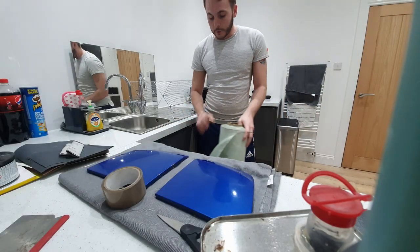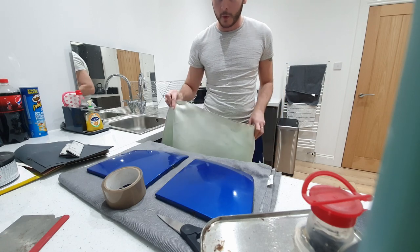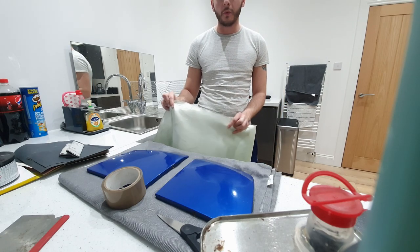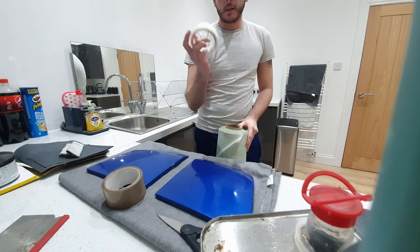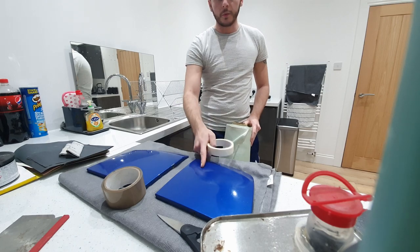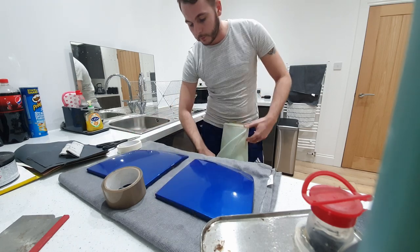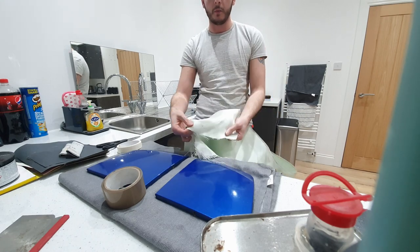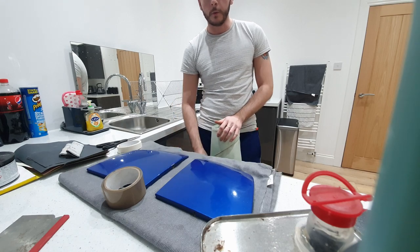Don't quote me on the name, but what we're going to use is actually a finishing fibre — that's what I believe it's called. It's actually like a glass fibre that's woven, sort of like how your carbon fibre would come in. What I'm going to do is put some masking tape to the size of the panel and then use scissors to cut it out, which will save it from having the frayed edges. Previously we haven't done that and as you can see we've used quite a bit and it's all frayed.